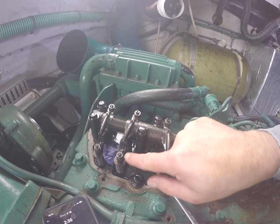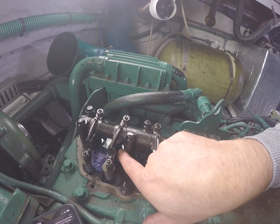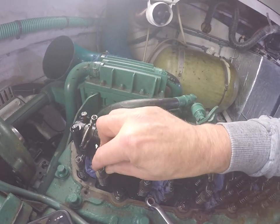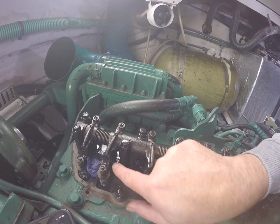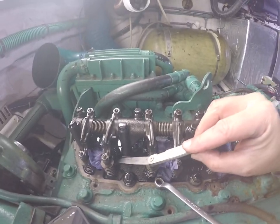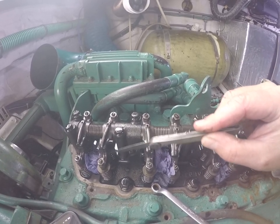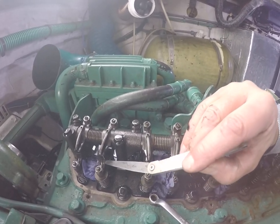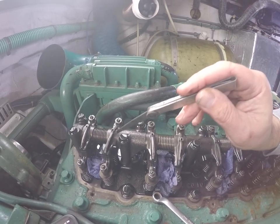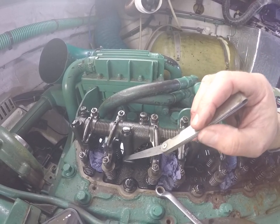Here is the rocker. The idea is that you want to get it equal between this valve and that valve. This isn't a clearance valve — it's more just making sure that when you push this down you've got an equal spread between these two. The reason for that is — and this is why it needs to be done every 200 hours — these posts here, if these two are out significantly, when this is pushing down it's going to be pushing sideways. If it pushes sideways there's a chance it will break, either crack that or crack the post, and if that happens you can trash your engine. This is why this is done every 200 hours. I'm not 100% convinced, but apparently there have been occasions when this has happened.